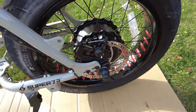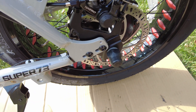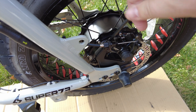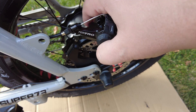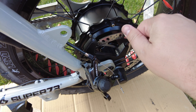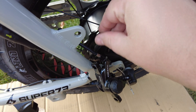Let's see what it'll take to get this thing on the ZX. I'm going to start with the rear brakes first, no particular reason. With the five millimeter hex key, we will loosen it up here. With the bolts out, this should just slide right off your rotor. Then screw the bolts lightly back into their holes so you don't lose them.